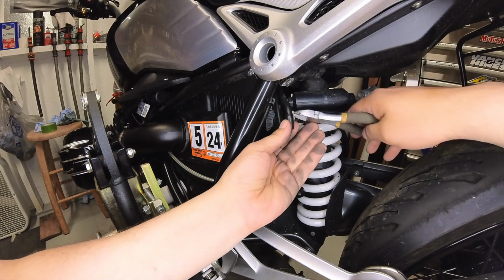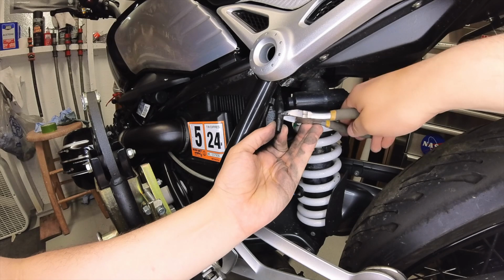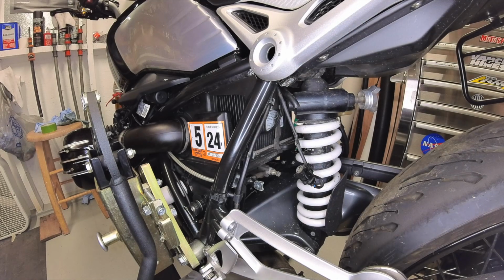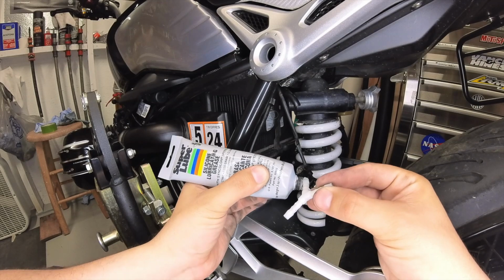The next step is to remove about 1 inch from the upper hose. Technically, remove the part that was expanded to fit into the charcoal filter. This is where the Y connector will be installed. Add some lube to it to help it slide in.